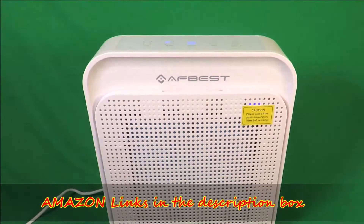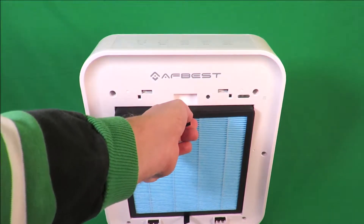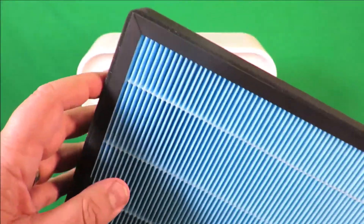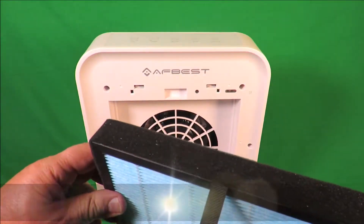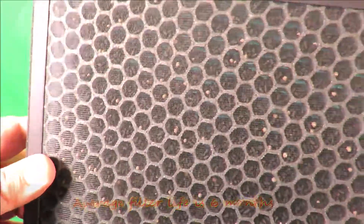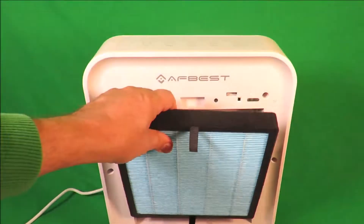At the heart of a good air purifier is its filter. Just take this cover off. When yours comes, it'll come in a plastic bag — you need to make sure you take that off. One of the signs that this is a good quality unit is you've got sponge here, so it's a good snug fit. If you haven't got a good snug fit, the air will take the path of least resistance and actually go around the filter and miss it. This has a four-stage filtration process. You've got active carbon, which will remove smells, dust, pollen, smoke, and even some nasty chemicals.